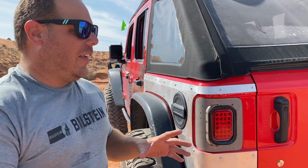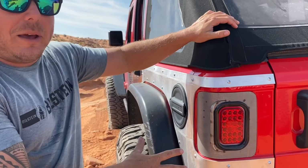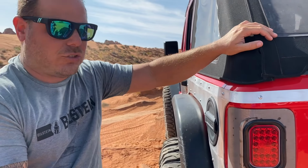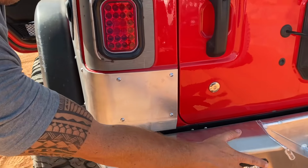Ripped off a taillight on the Rubicon out here at Sand Hollow. I think it's been about 5 taillights now that we've either pieced back together or just had to replace completely. So now we went with flush mounted taillights. This is the rectangular, it's just an LED trailer light. Now these don't have built-in backup lamps, which is why we put them in the bumper.